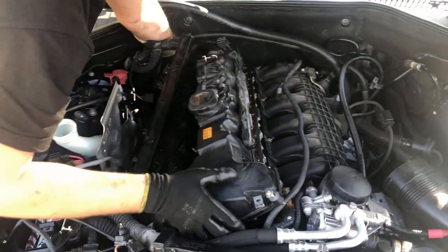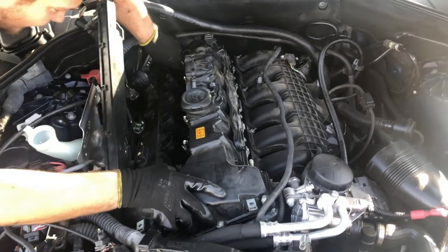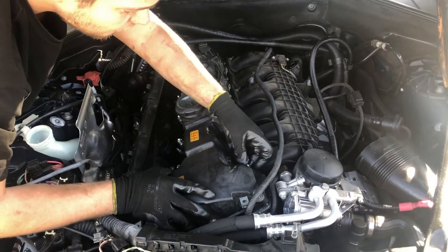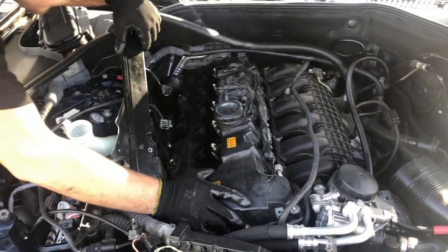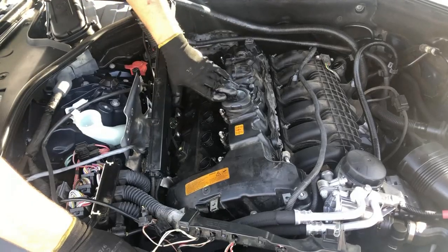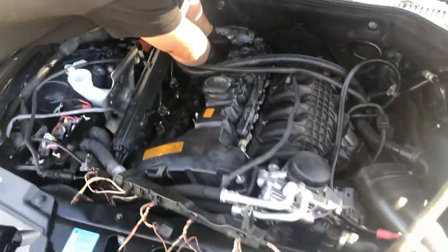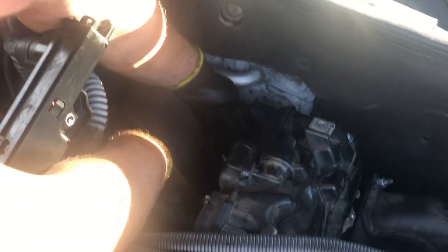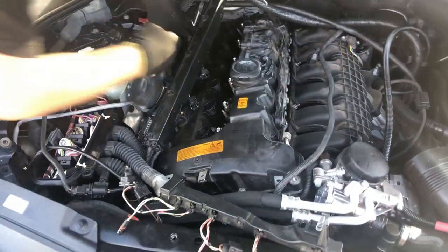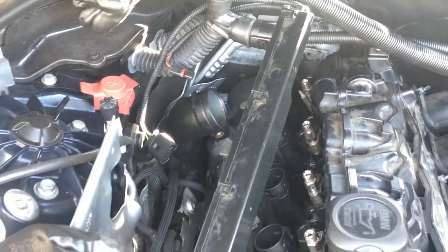Feel your gasket with your hand. Now just push it down. To verify, just lift every corner slightly and feel the gasket - if it sits flat. Go in here, you can feel it everywhere, in the middle as well, because this is very important. Check the back corner near the turbocharger pipe especially - this is the most common place where it can fail.